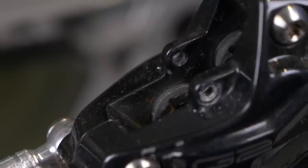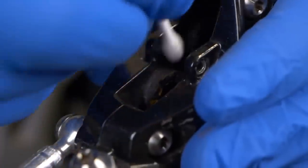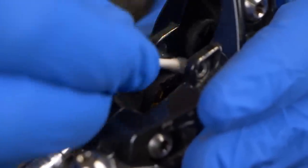Those seals are essential for making them retract. Now — this bit is vital — depending on the model of brake you have, you need to use the same oil that's already in the brakes. If your bike has Avid or SRAM brakes with DOT fluid, use DOT fluid. If it has Magura brakes, use Magura Royal Blood. If it has Shimano brakes, use the Shimano brake fluid. Remove your brake pads, remove your wheel, then carefully squeeze your lever until those pistons come out — normally white in colour, probably dirty in your case. Don't push them out too far; expose enough to clean them, then using a cotton swab and the relevant oil, clean the sides all the way around, and push them back into place.